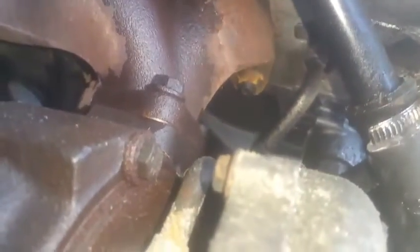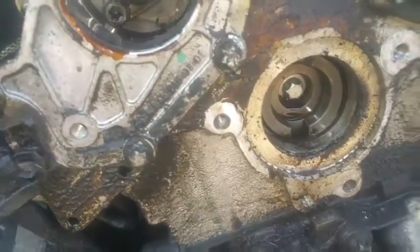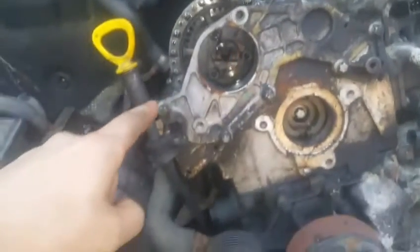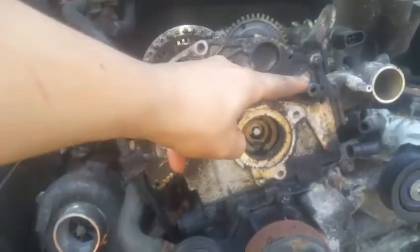It's held by a number eight type bolt. So first I'm going to remove this oil tube. I'm also going to remove this high pressure fuel pump bolt, and also this plate — to give me some easy access. This is called the head plate, right here.